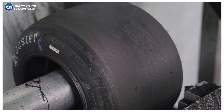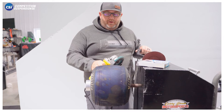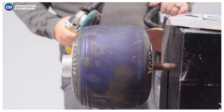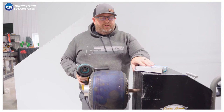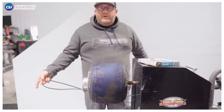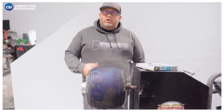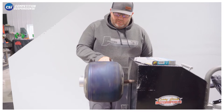For those of you who don't have a tire lathe, that's no problem — we're going to show you how to do it on a machine to get a similar finish. We're now over here with another blue, sealed-up tire. You can just sand across it and probably get rid of that blue, but the problem is you're really not getting down to fresh rubber the way we want. So the first thing we're going to use is a Cuts-All shaping disc — this is a medium — it's a metal disc and you have to be careful because it will remove quite a bit of rubber. We'll take some rubber off, then go back and finish sand it, and then we'll show you how to prevent these things from getting blue again.